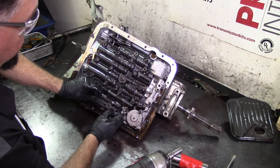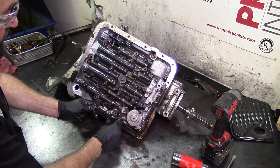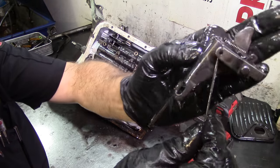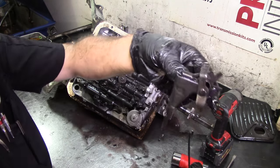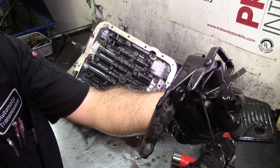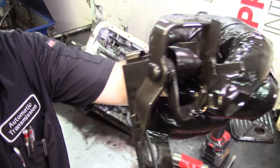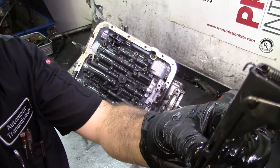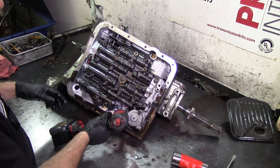This is the mechanism for the throttle valve. Get it out of the way so it won't be in the way — sometimes it gets stuck on the roll pin. Let me show you how it goes: there's a little wire clip with a specific shape to it. You can install it wrong and cause shift issues. This one goes on the inside — if you put it on the outside it's going to bind up and you'll have extremely late shifts or the transmission won't shift at all.